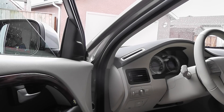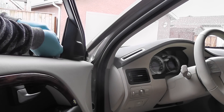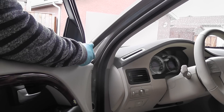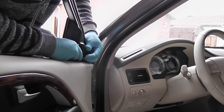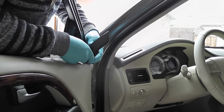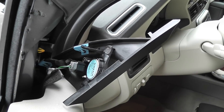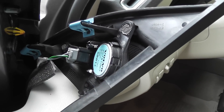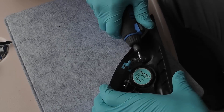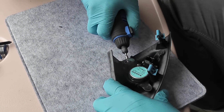Let's begin with the installation. Open the window, unfold the mirror, and just use a bone tool to pry out the speaker — pull outwards from the door and it will pop out. There are two blue metal clips that hold the speaker in place. That's how it looks from inside. Disconnect the connector and it's in your hands. It takes exactly 30 seconds.